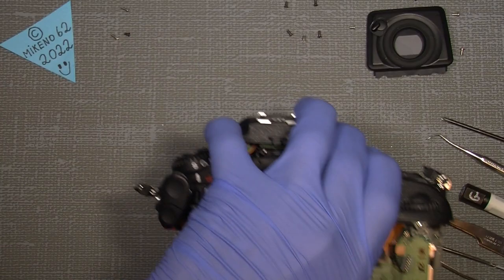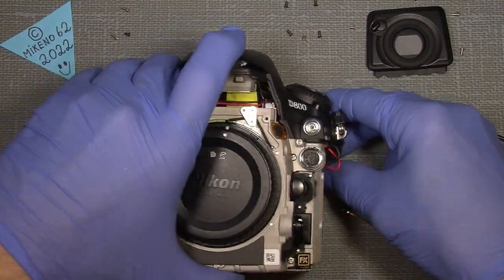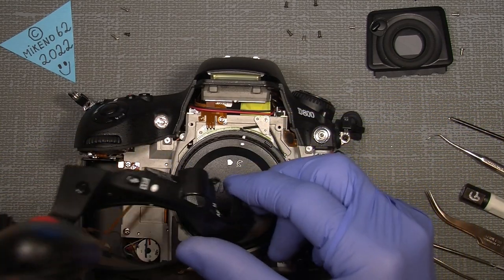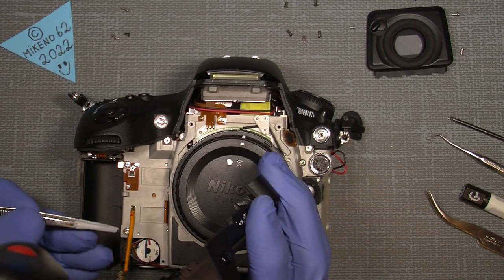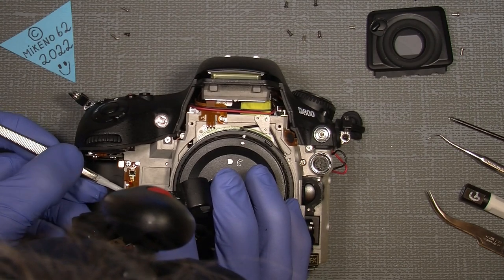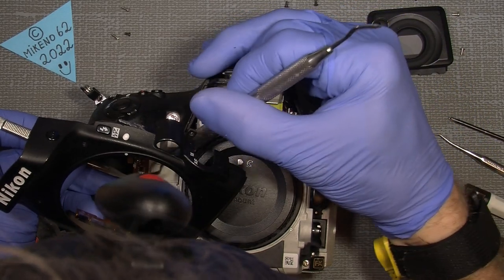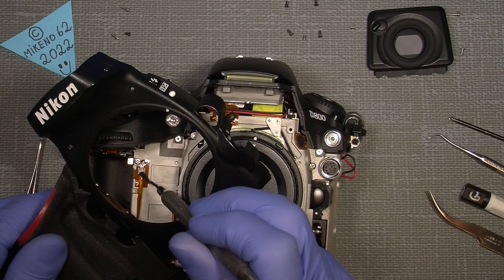And what else to do? Just the front, the whole front section comes on here. And remember the little tiny flex cable has a little mark on it, which I set before I took it apart. And just put it in here, into the connector. So, and then press down the little black thingy as it says click. So you can see the little black thingy here.